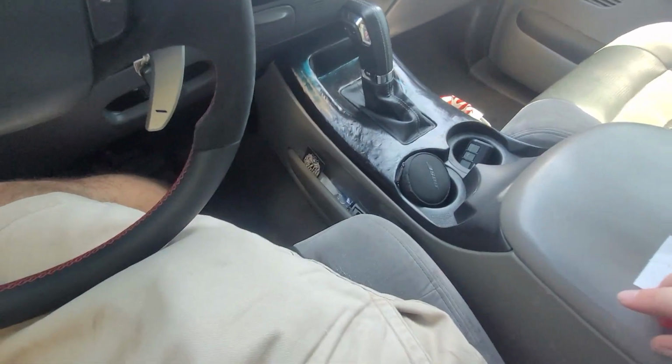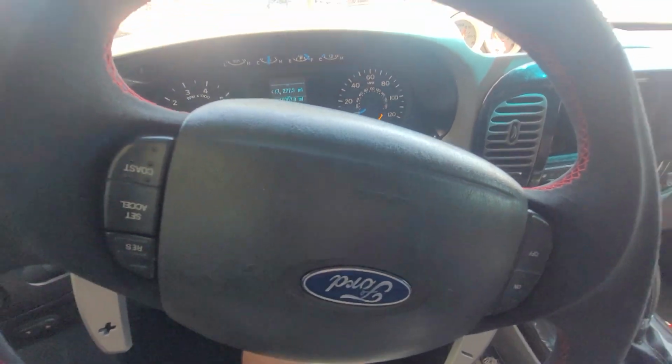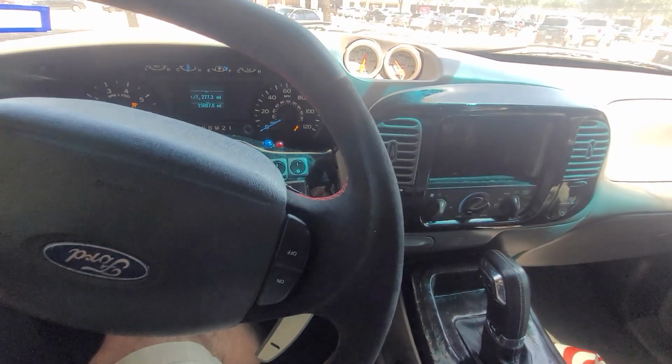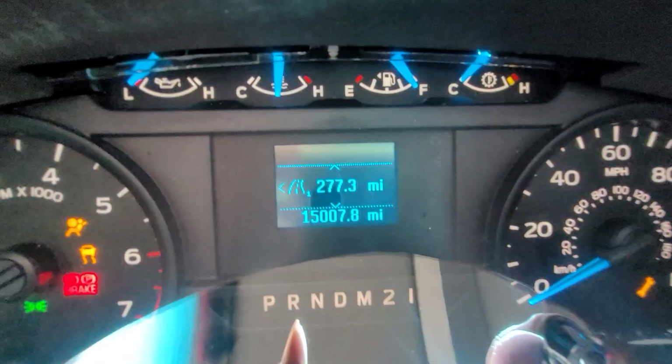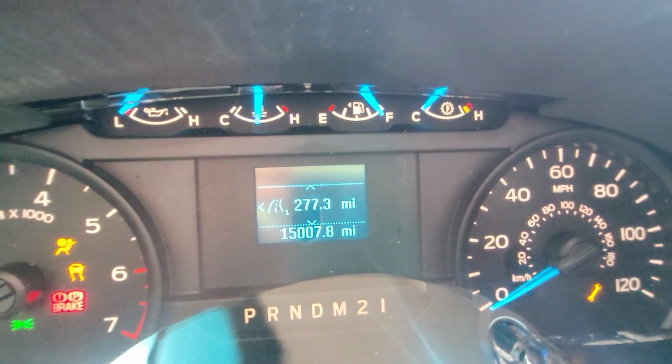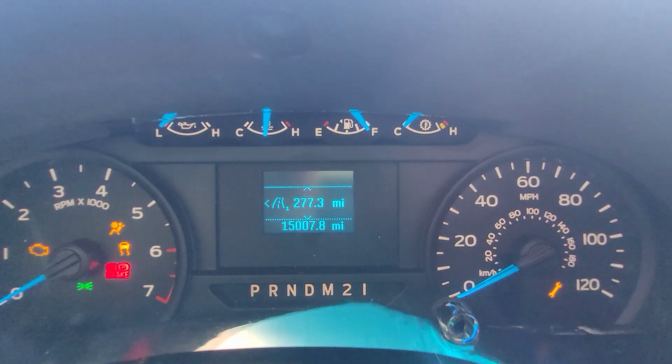Well, I was putting a little bit of gas in it at a time to check on it, and I stopped at 4 gallons and the gauge didn't change, and then I stopped at 7 gallons and the gauge didn't change, and now I'm at full, or almost full, with 14.5 gallons in it. So that's probably about as full as it's going to read, which is okay with me. That's much better than we've ever had before. That also means that the gauge will show empty at approximately a third of a tank left. So overall, really happy with that effort today. And now she's got E85 in the tank again. So let's go party.